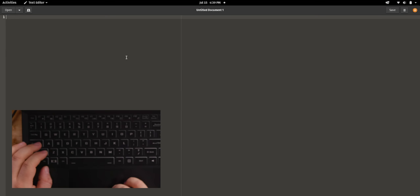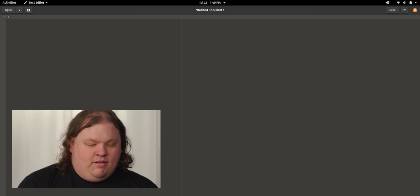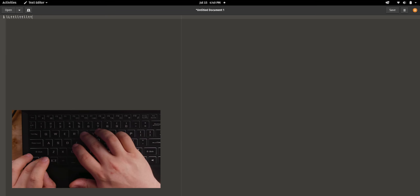All right, we're back. Let's open up our text editor and see what happens. Function T — that looks like an L. Shift T — that is capital L. So basically I can make any key on the keyboard any other key on the keyboard. You can change the layout at your own whim, and that's just the start of it. You can change the fan profiles, all kinds of stuff in the embedded controller. The embedded controller handles power delivery, fan curves, voltage curves, frequency curves — all of that stuff — and it is completely open for you.